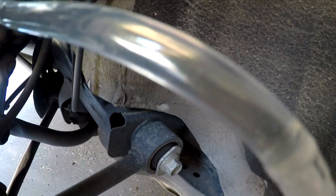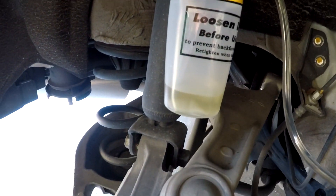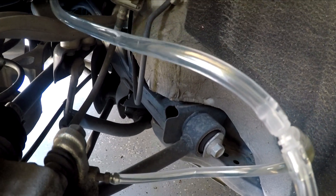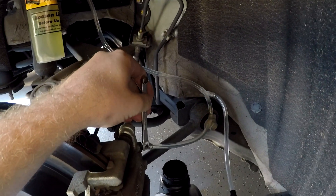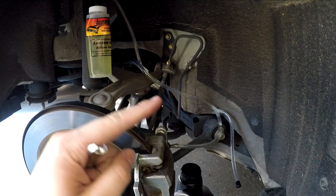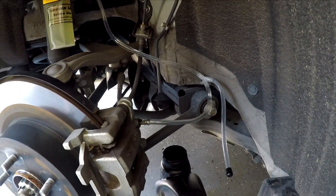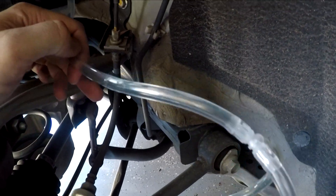The fluid has begun to bleed now. It might be difficult to see — the camera doesn't really focus closely — but I've got some little tiny particulates kind of making their way up through there, and you can see the bottle starting to fill. I'm going to let this run for a couple minutes and go back to check my pressure to make sure everything's good. I'll go ahead and shut the valve off when I stop seeing any little particles coming through. I think this side is done. I went ahead and already tightened that valve to shut it off. I probably bled a little too much — I almost filled the entire bottle. When you're bleeding, keep an eye on the bottle level and make sure you don't overflow it. Also, keep constantly pressurizing the tank up top to maintain 15 psi, because when you start to bleed it, that pressure is going to want to drop. The fluid is completely clear now — it's changed color from that goldish color — and I'm not seeing any metal flakes, so I think this side is done.